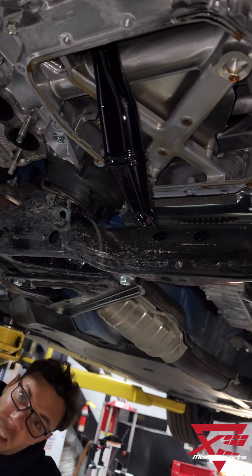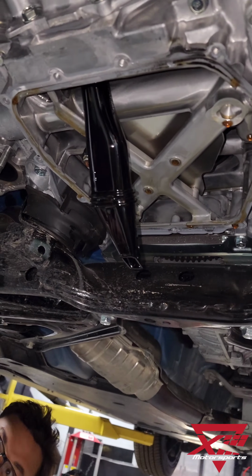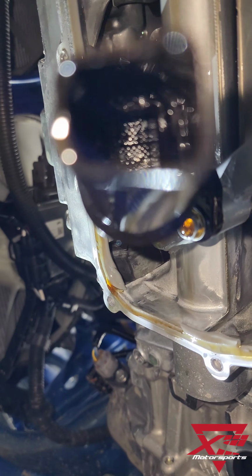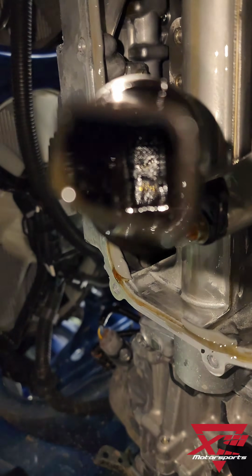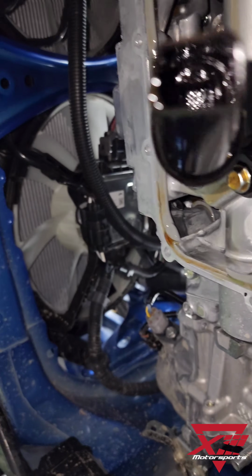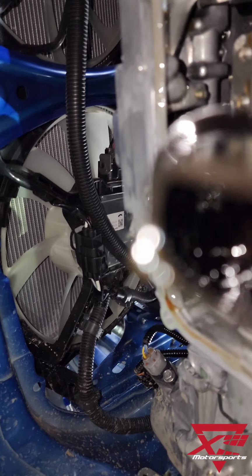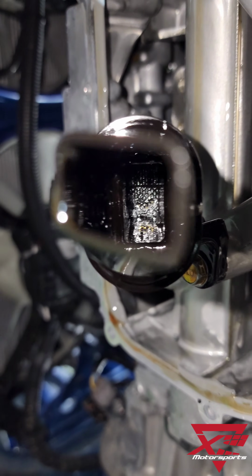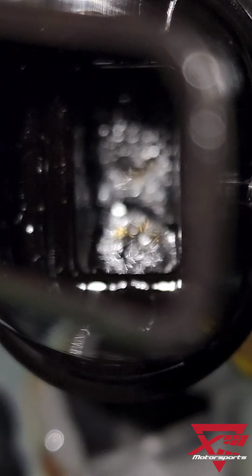As usual, there was debris in the oil pan. This car has 4,000 kilometers on it, and based on our own experience with our own car, we've seen this build up repeatedly on the same cars, every couple thousand kilometers. So you can see on the main screen in the back there's quite a bit of buildup there. Pretty typical, nothing really surprising at this point.